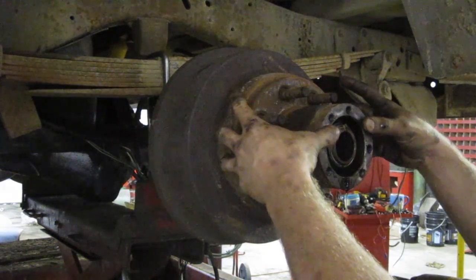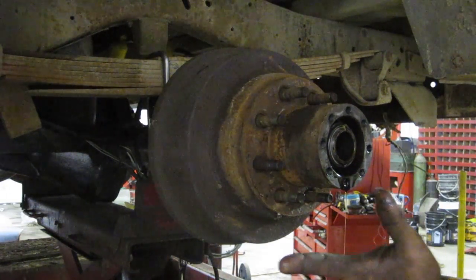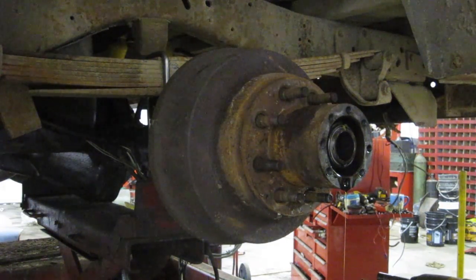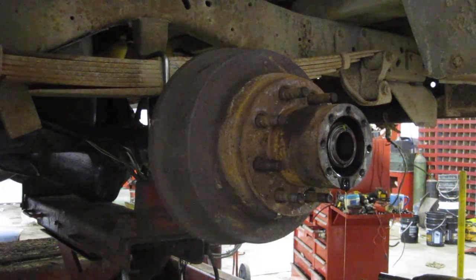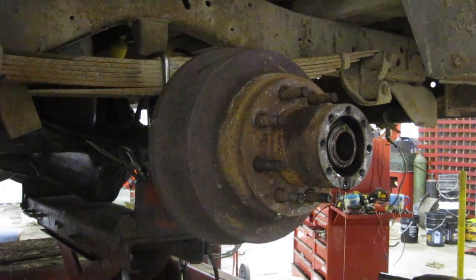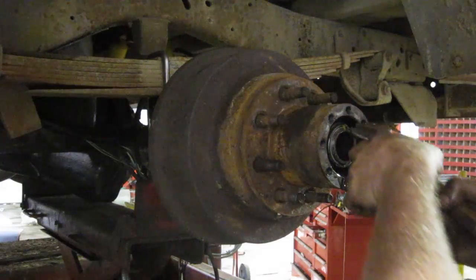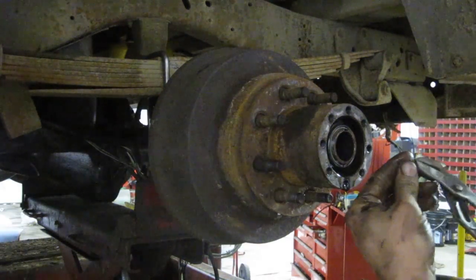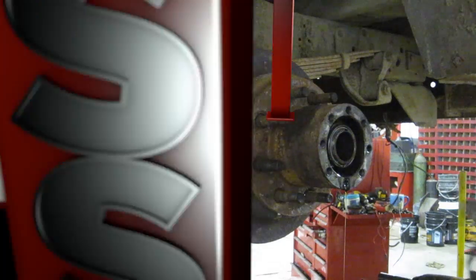When that nut backs off, your whole axle comes out, and you'll be looking and your dual will be about 4 feet beside the truck, just resting on the axle. Lots of damage, you pretty well have to replace the whole diff and assembly, so just do yourself a favor and get a new nut and this little piece here. And it pops right out, but even still, I'm always nervous.